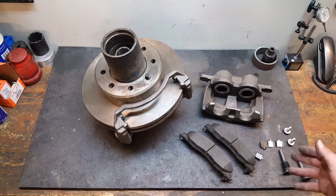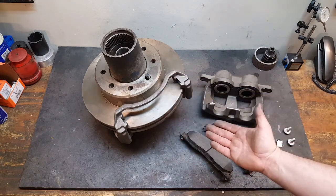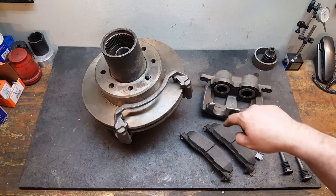A couple of commonly asked questions: what size wheel does the kit fit? We've found the best approach is to use a 17 inch 8-lug wheel or larger. We've had the best luck with 4 to 4.5 inch backspace, but the kit does seem to accommodate a variety of wheels. The other common question is whether this kit fits a dually hub — the answer is no. The reason is that the hub face where the rotor mounts is quite a bit more outboard when you measure that distance down to where the spindle registers onto the knuckle.